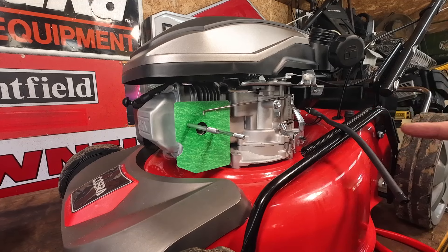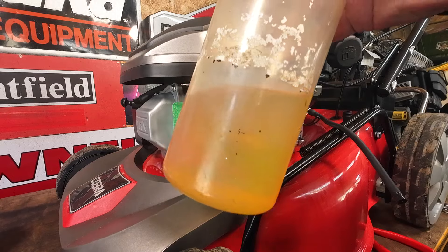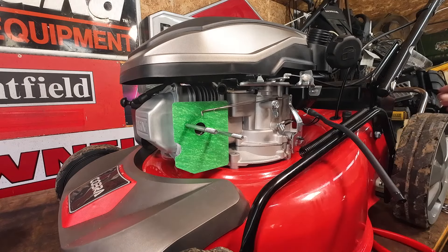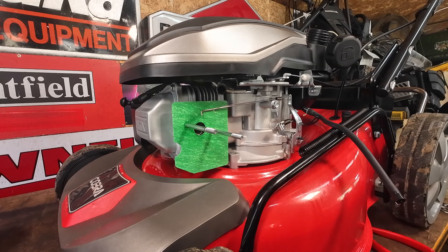Fuel is now draining off lovely. There's the colour of the fuel left in it from last year — nice and yellow. If it looks like a urine sample, looks like something you'd take to the hospital, chuck it away, get rid of it, dispose of it properly. It ain't no good. Unleaded fuel will only stay for about 30 days in the UK.